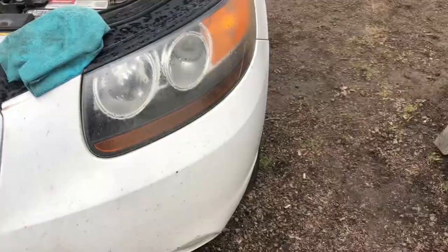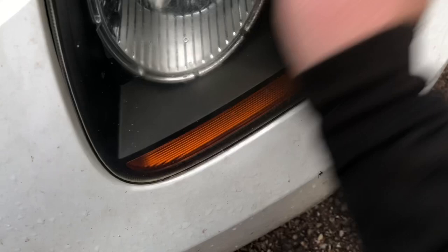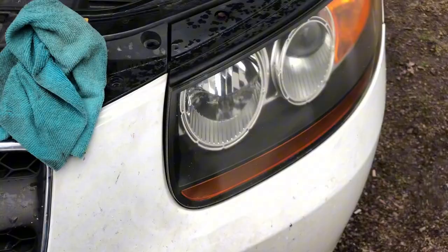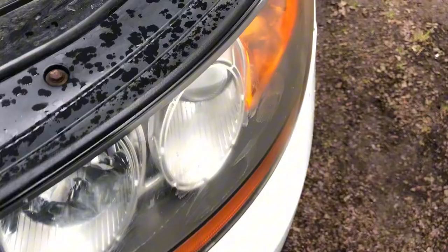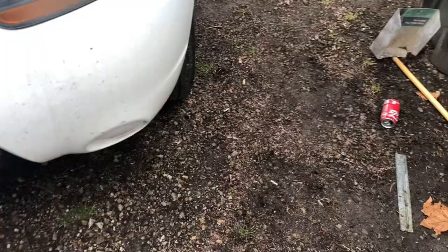You gotta see a huge difference. Y'all, you want to keep this wet — soak it up. That's the before when it's wet, that's the after when it's dry — looks the same but this one's clear and this one's hazy. Basically all you gotta do is dab this, get it super wet, then go really fast. I'll do that off camera and show you guys what it looks like when I'm done. This is 1500 grit and I'm gonna move up to 3000, then we're gonna polish it.